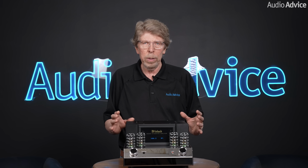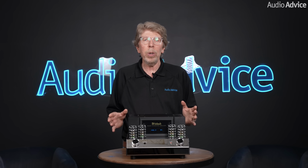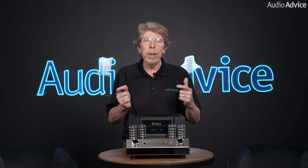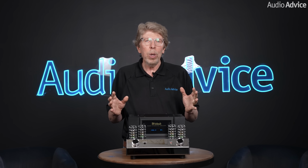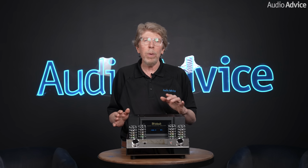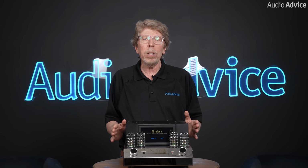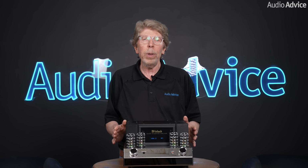Some of us have also made the mistake of moving or connecting speakers with the unit turned on. If the positive and negative speaker leads touch each other, you could damage your amplifier. McIntosh Sentry Monitor will shut down the MA252 if it sees a short, preventing any possible damage. A side benefit of this tech is there's no need for bad sounding fuses in the signal path like most amplifiers have. And for those times when you want to listen and not disturb anyone, there's a powerful and outstanding sounding high drive headphone amp built into the MA252,